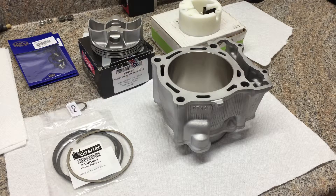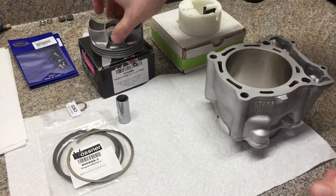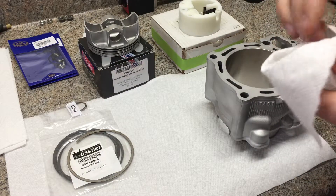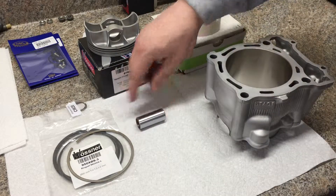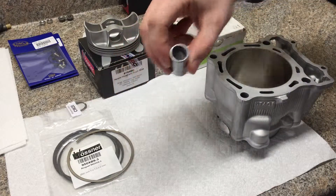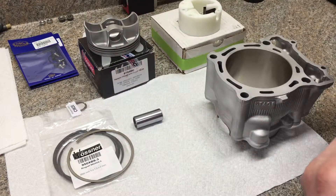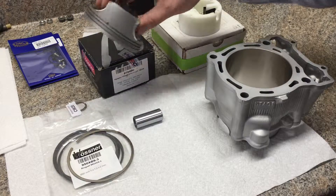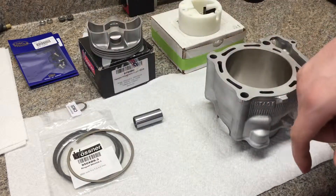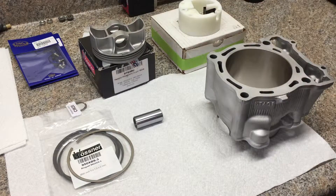I did a previous video about wrist pins — I'm going to be using the WPC treated wrist pin. WPC is a company based out of Japan that does metal surface treatment on engine and transmission parts, bearings, anything that slides against something else. I had some custom DLC wrist pins made, however the wall thickness was a little bit too big and the pin was too heavy, so I'm going with the WPC pin. I'm a little worried about pin galling and pin wear and piston bore wear, but given the features of this piston and adding the oil squirter from the '07-and-up engines, I think I'll be fine. Maybe I'll do a teardown next year and see how everything's faring, because wrist pin galling and wear in the pin bore is a big concern in these engines.